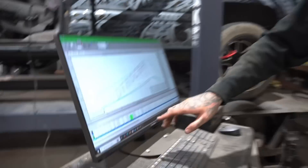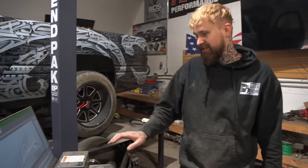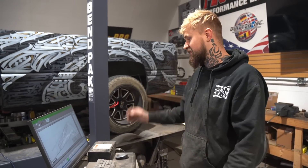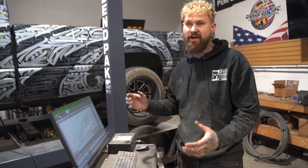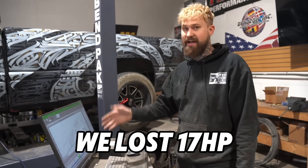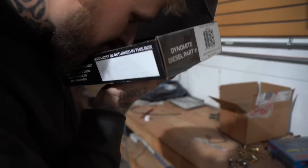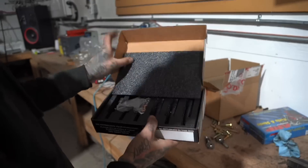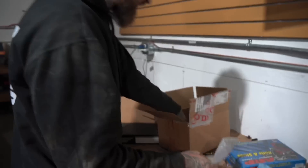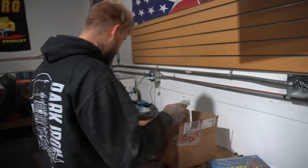Our best run gave us 238.7 horsepower and 501 foot-pounds — that was the third run with a little load added. Still not getting peak boost though — we just need more fuel. This shows you that just because you put a big turbo on your truck doesn't make it faster — it actually makes it slower. You have to do the supporting mods. So we got to do injectors: we have the Dynamite Diesel Products injectors here, and we've also got delivery valves and springs for the pump. I've never really worked on a P-pump before so we're going to have to figure it all out, but I'm really looking forward to it.